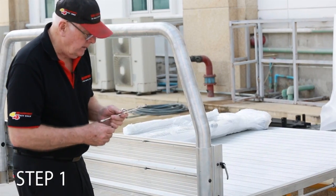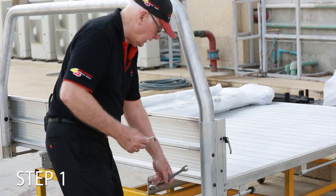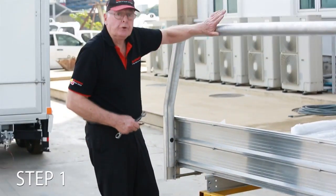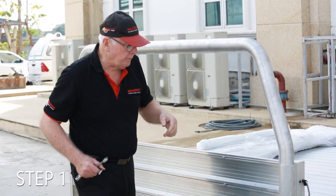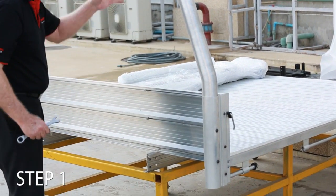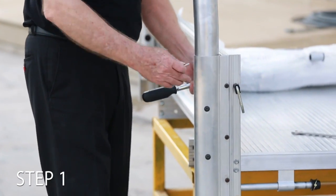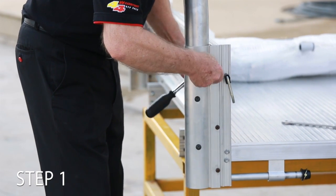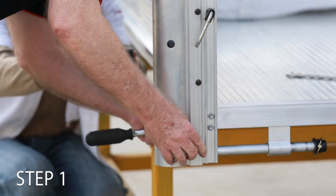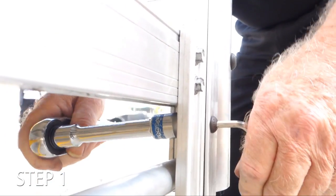We then take our spanner and we do up the bottom 2 from underneath. Because it's difficult to get the nut in, we put the big hole there, okay? So we'll put this up in here. Okay, so that's our pipe headboard in place, nice and solid. Now all we need to do is do up the 3 little ones here on each side, and the headboard is mounted in place, and then we'll put the 2 headboard upright brackets in here. Now all we need to do is tighten up the 3 smaller bolts that bolt the headboard upright to the headboard upright mounting bracket. Once you do the nylock nut up, it's not going to come undone. So that's those 3 done. That's all bolted nice and tightly.